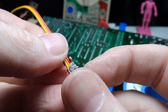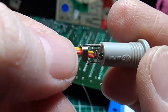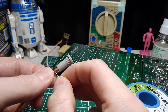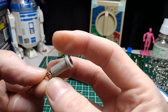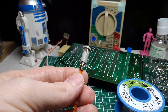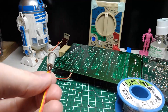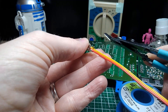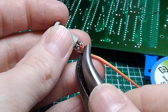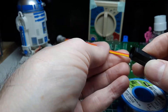One thing you have to do to get pseudo stereo sound is to connect the two audio poles together. I'm going to use a leg of a capacitor and connect it from one pole of the audio to the other pole so you get left and right sound — it's not real stereo, it's just duplicated sound out of both channels. Trim them so that it fits together well, and also clip down the holder so that the wires don't pull out if you yank on the cord. Nice and snug — our TRRS jack is soldered up.